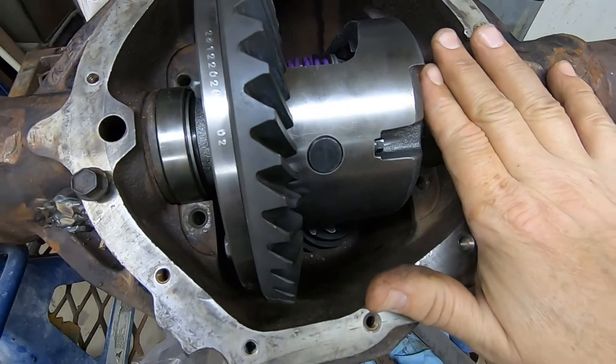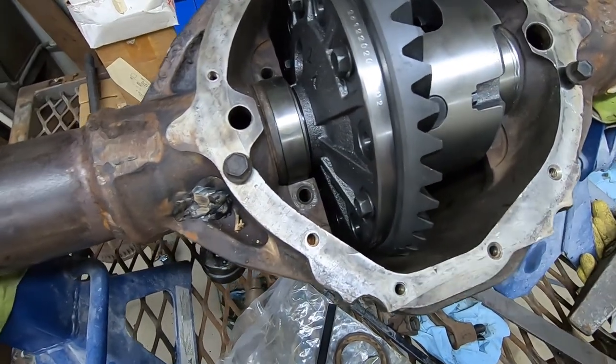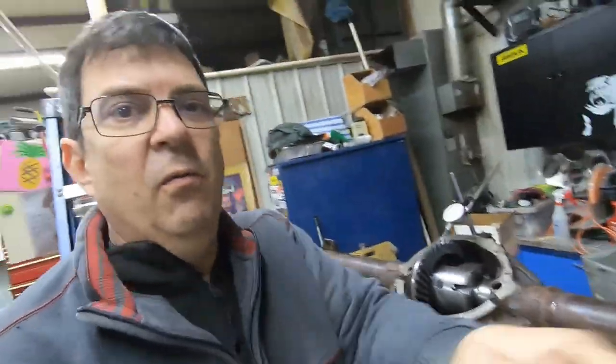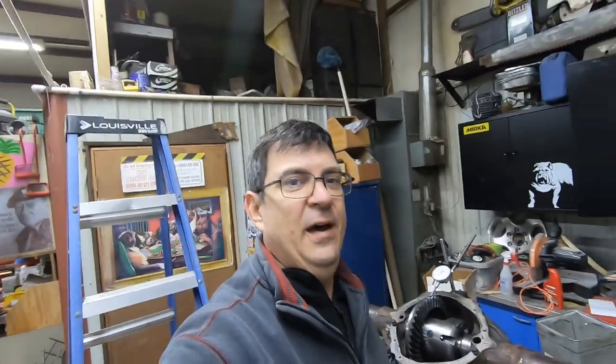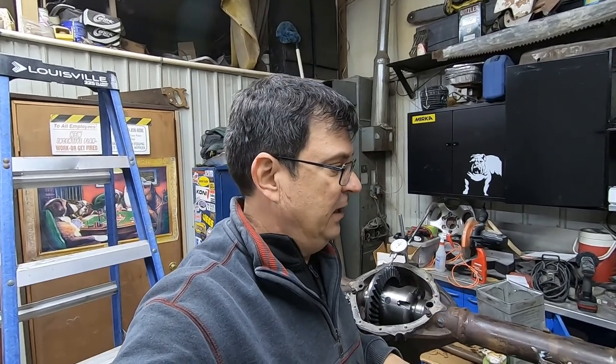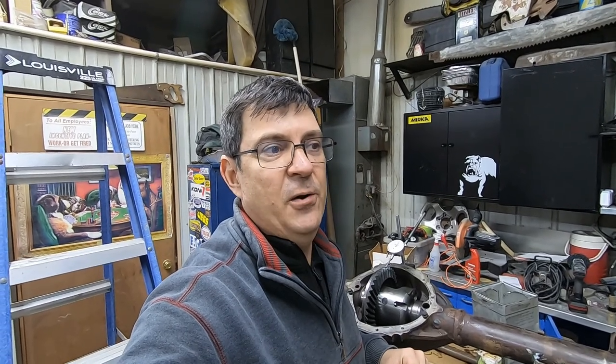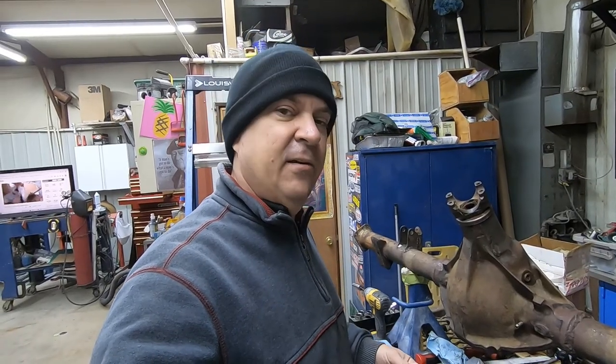Now I'm going to go ahead and bolt these caps on, torque them, recheck everything. One thing that I've found that's really good when you're doing this kind of stuff, if you have the time, get things close and stop on a happy point. Don't stop, fight it. If it's fighting and things don't seem to want to go, walk away from it for a little bit and come back. I torqued the caps back down on it.